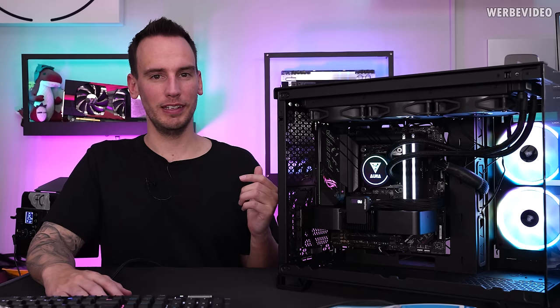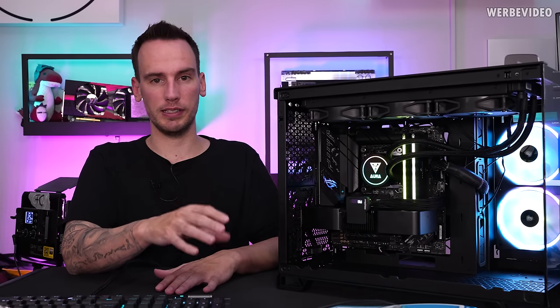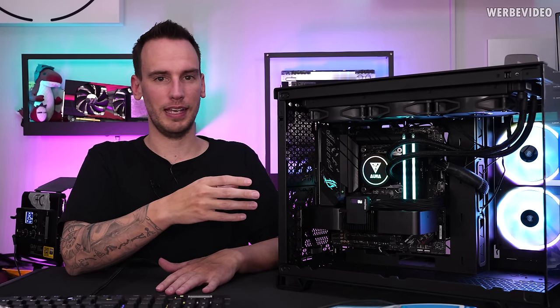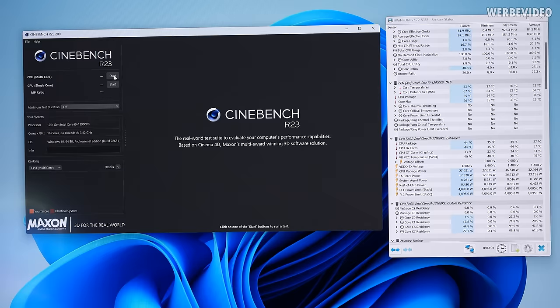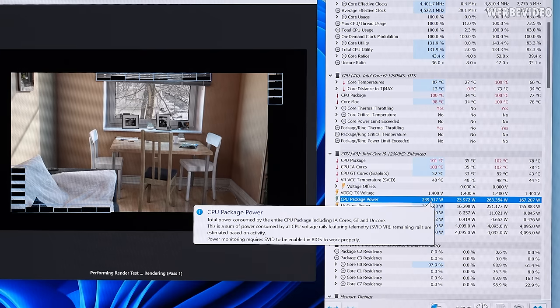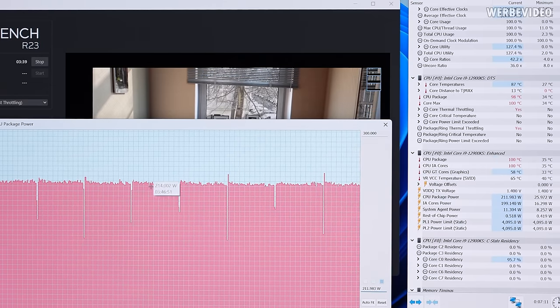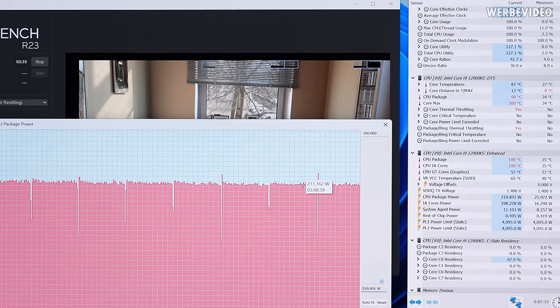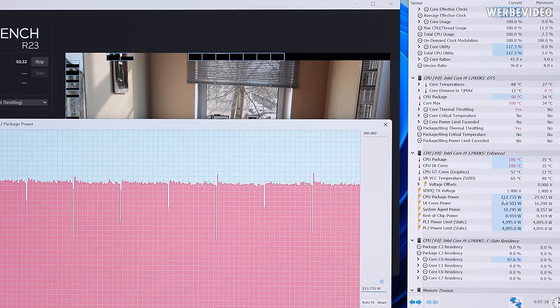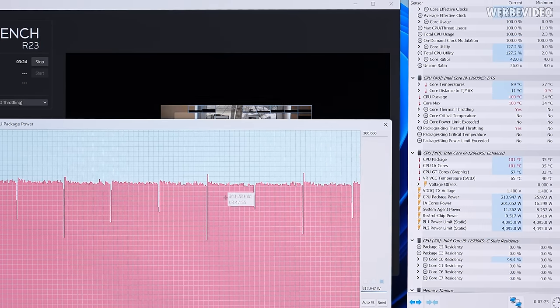This beeping noise is insane. I had to go back from DC to PWM because I couldn't adjust the fan speed in DC mode, and in DC it was just running at full speed. I want to see it at 40 decibels, which I'm now at — but that's insane. Let's check the cooling performance. Now time for Cinebench again. It goes straight to 100 degrees Celsius immediately, with only 240W package power, and it's going down. After about six minutes of constant load in Cinebench R23, the CPU package power draw is at about 210 watts under load — which is about 30 watts less than the Corsair H150i.